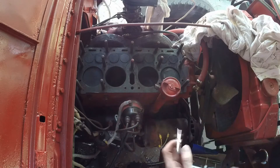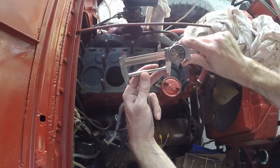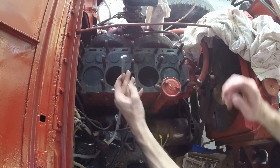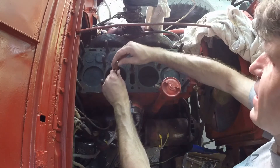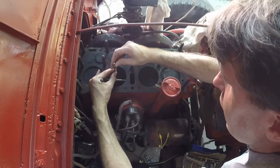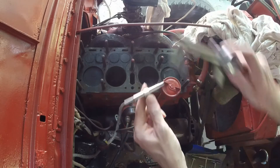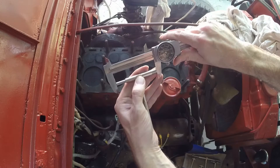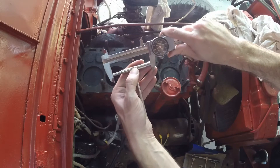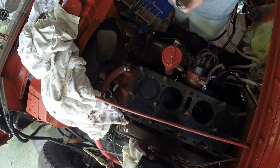About 40 over — that's not super accurate; I'm not sure if I have it exactly square in there, but it's pretty close. It just gives you an idea of how much your cylinder bore is over and if you have a really oblong cylinder. I want to take it on the other axis now and see where we're at — and we are about the same place, so we're good there.